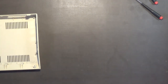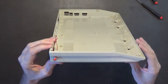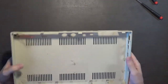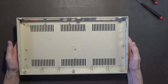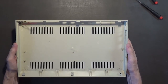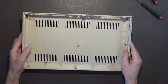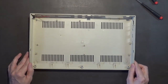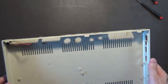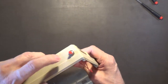Now let's look at the bottom of the case. Some person put a reset switch right there, which is stupid because a lot of utility cartridges already come with a reset switch. If you're going to add a reset switch to a Commodore 64, don't drill holes in the case - even for JiffyDOS, just don't do it. These cases are getting hard to find. It would be better to put a reset switch in one of your cartridges that plugs into the computer.